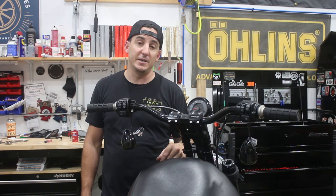The 2022 Lowrider S is ready to go up on the dyno — pipe, air cleaner, everything installed. Got it warmed up, oil level is good, everything running fine, new cam install went really great. We've got a reasonably close base map from another project we did that we're going to start with, so I think this should go pretty quickly and we'll be able to get some results soon.